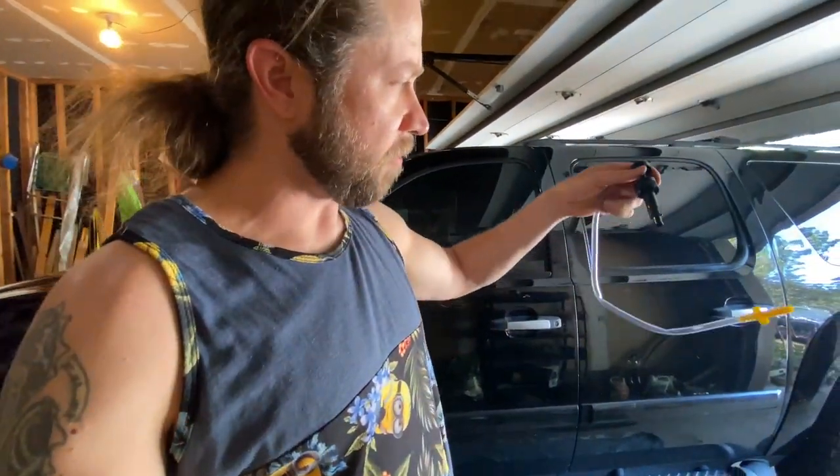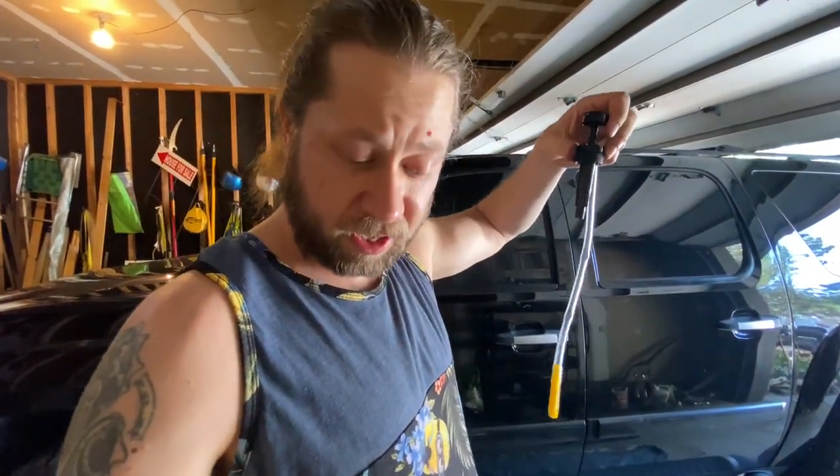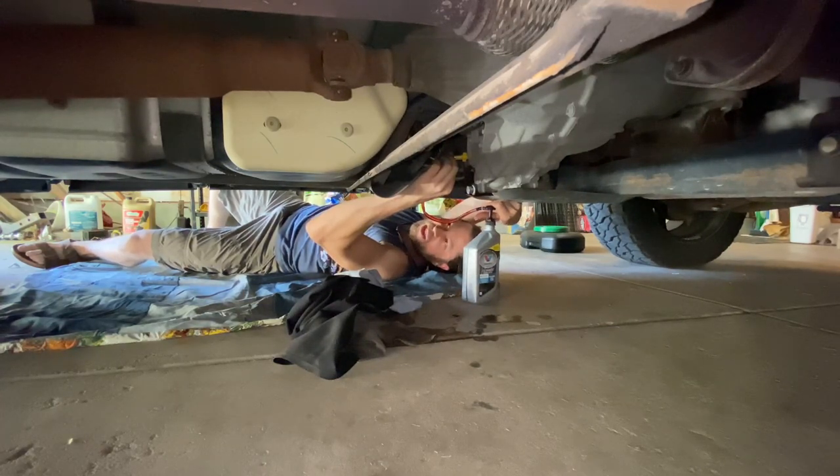I got a five-dollar marine filler pump here, supposed to just screw right into the lid of the fluid and pump it in. I read this will take exactly two quarts, and I've got two quarts here — we'll see if I need to grab a third to get the last few drips in. A mechanic in a shop with a lift who knows what they're doing would probably get this job done in 10 or 15 minutes.